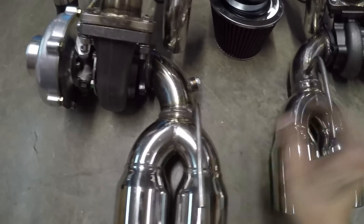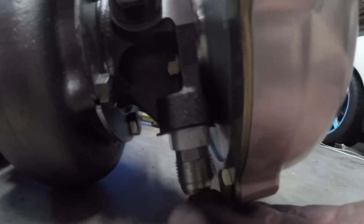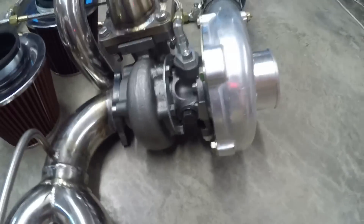I'll take another quick snapshot whenever I get everything put together. Alright, got everything assembled and we're just about to do the pressure check. Here's the rear end — the business end. The exhaust tips go right there, got the waste gates right here, got everything bolted to the turbo. Got my oil lines plumbed in. These are the pressure lines; the return line is actually down there on the bottom. It dumps into these and goes into a Y, and goes into this heavy duty marine pump.